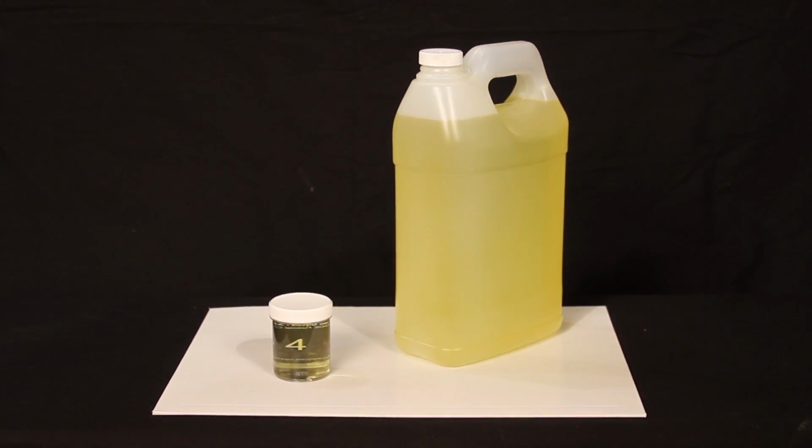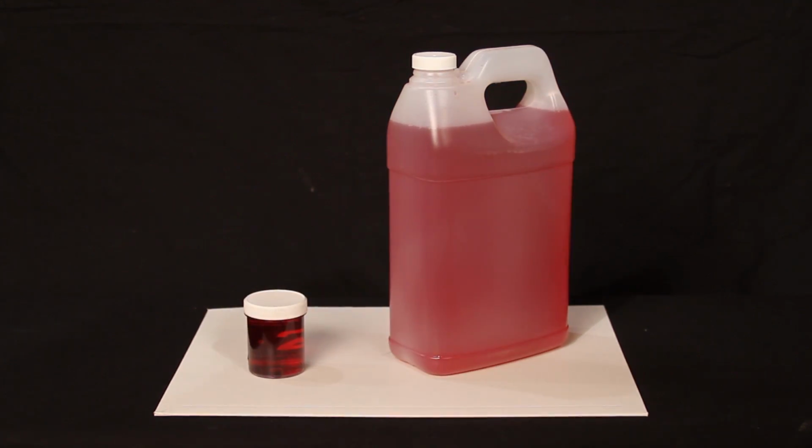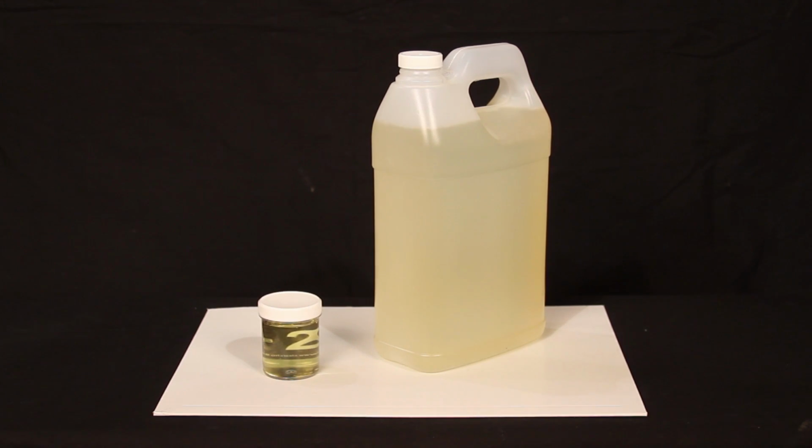The pH of the coolant for gold, orange, and red products can be lower than that of conventional green. Hybrids and OATs may drop as low as 7.5 before one could be concerned. Polyorganic antifreezes can display a pH of as low as 6.5 before there should be any level of concern. Once again, we're looking at the clarity of the coolant as a key part of determining its health.